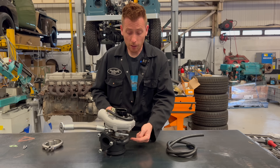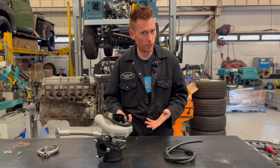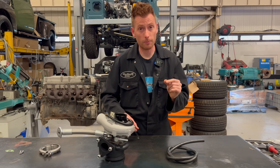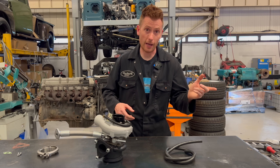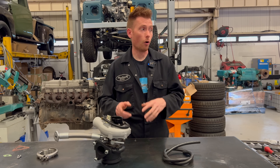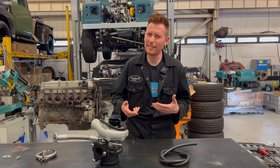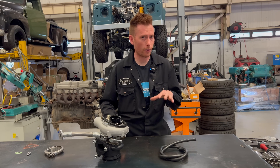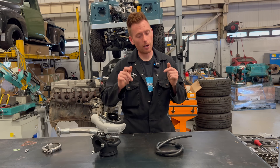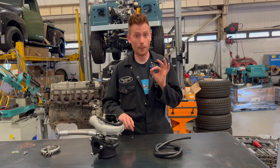Also the housing that you can see — these housings are original Mercedes housings which we remanufacture. All the hybrids were the same: they'd be remachined and the new cores would go inside. These are no different, apart from we've gone to the absolute maximum with the standard wastegate — we've made that huge to be able to get that back pressure away once the wastegate opens. And we've also welded up all the cracks in the housing. It's very normal when you get a hybrid to rebuild it to have cracks in the housing — it's extremely rare, maybe one in ten, to find a housing without cracks nowadays. Most small cracks aren't an issue, however I wanted to go the extra step: grind those out, drill them at the ends, and weld them up. So when you get your new V3, everything's welded up before it's machined — that is like perfection that you're going to put on your car.